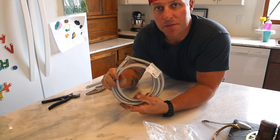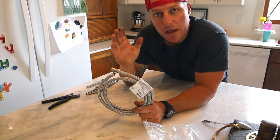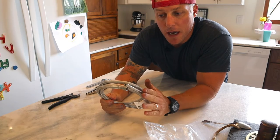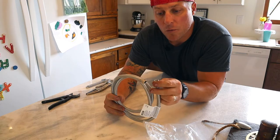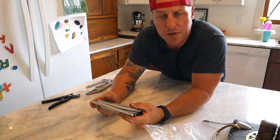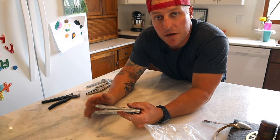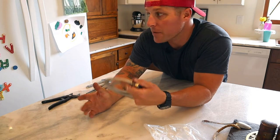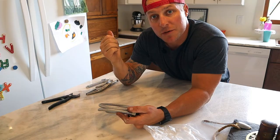Now that the refrigerator is out, we go to the options of our water line kit. They have several different options on the shelves, anywhere from a little plastic line to copper line to braided stainless steel. I opted for the braided stainless steel option and I'll go over that reason in just a minute. These are one-quarter inch thread size and they are a compression fitting. Some kits will come with adapters so you can increase or decrease the size of the fitting that they install behind your refrigerator. Before you select your size fitting, I highly suggest pulling the refrigerator out and getting behind there to look at the fittings and see what size you have.